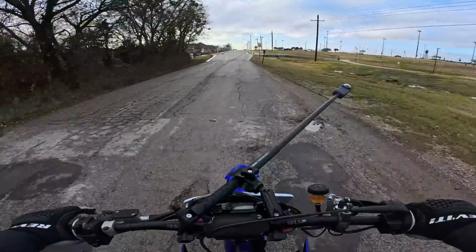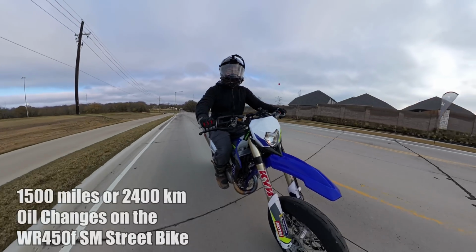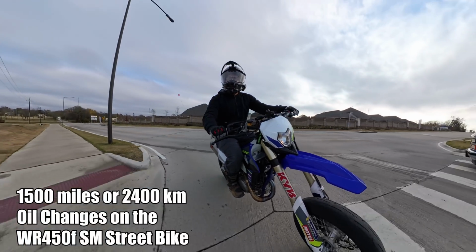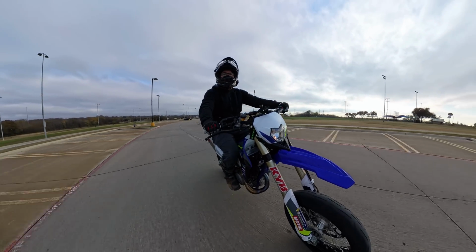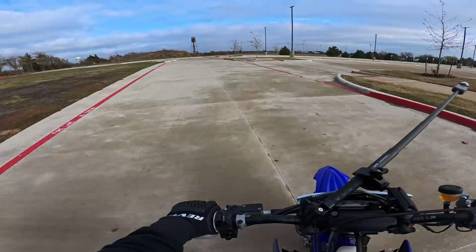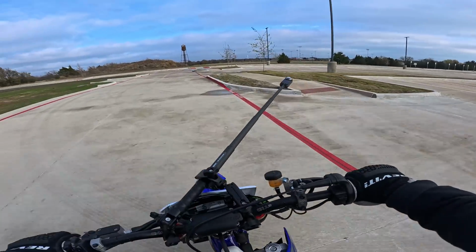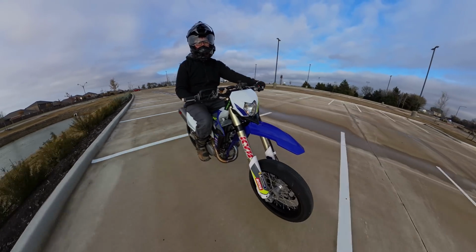You know, like around 900 hours on it when I got rid of it. And I started stretching those out to 1,500 miles towards the end there. And I would do the oil and the filter every time I did that. And I felt that that was just fine, though. I mean, the oil, even at that, really came out pretty clean, to be honest with you. So then every winter, I would just pull the valve cover off and check the valves. And out of that time, I think twice I had to shim a valve. Maybe I just got lucky. And it's just a single case study.